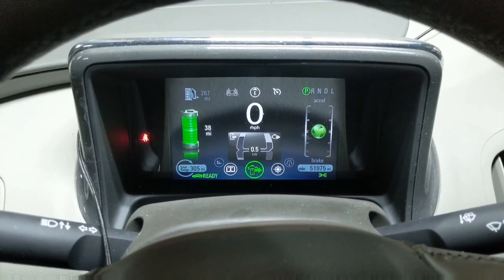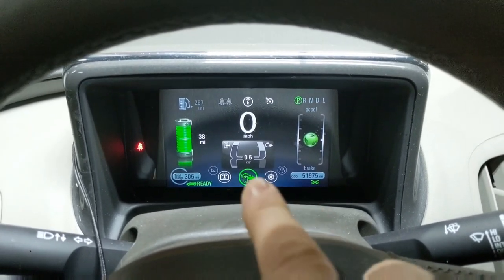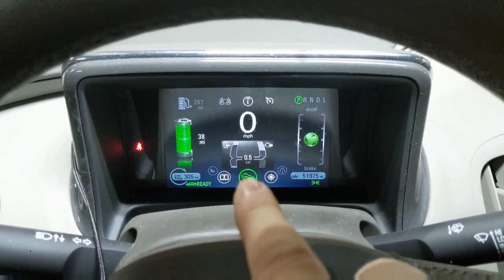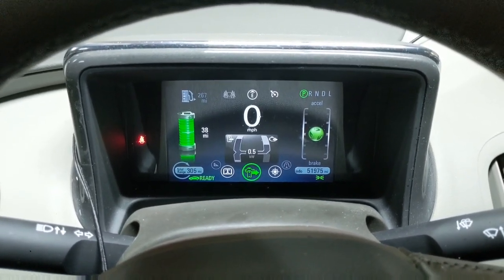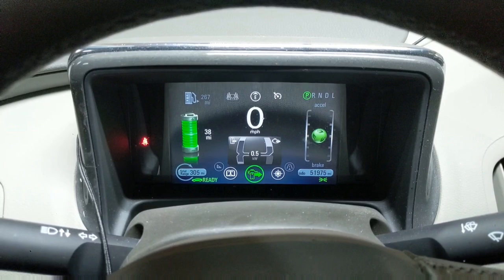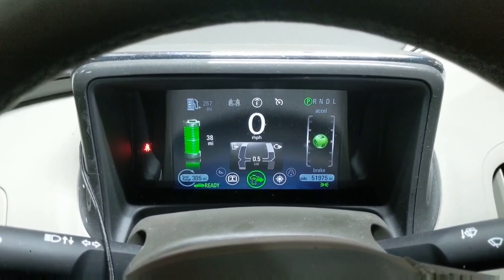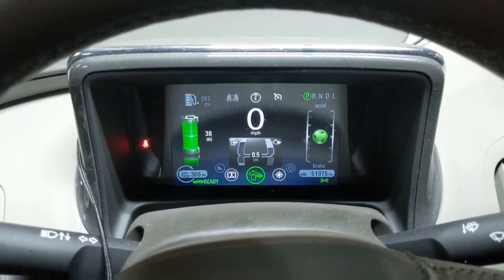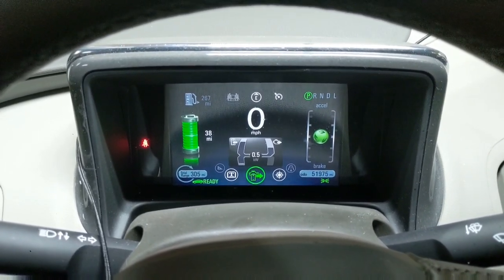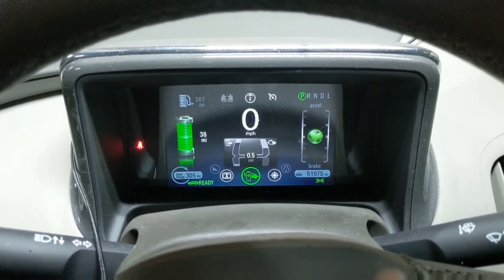We can test some of the components required to get heat inside the Volt without any tools. If you look at the dash, you can see a kilowatt meter. We're going to turn the heat on, and when we do, we're going to see the kilowatts spike a little bit, and that's going to tell us that the heating element is good. These cars have a heating element and also a pump. That pump flows coolant through the heating element, the heating element heats it up, and that's how the inside of your car gets warm.